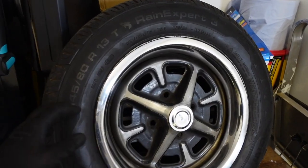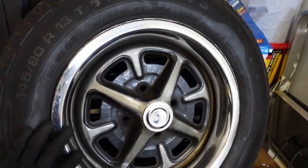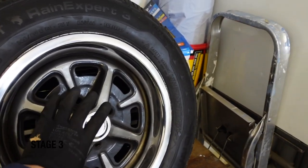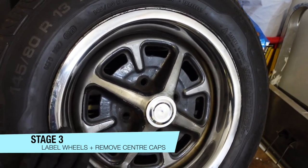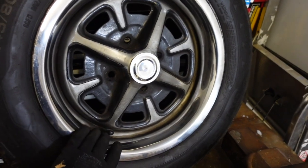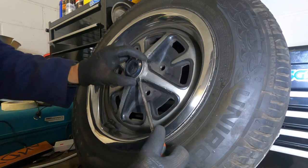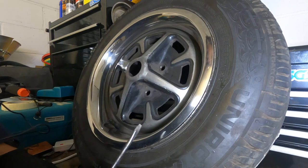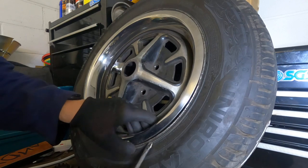Now the wheels are off and I've labelled them in a few places so I know which is the front right when I'm sat in the driver's seat — so I know which wheel goes with which hub. Next step is to try and find a way of gently removing these stainless steel or chromed vanity rings. Just a press fit I think. There we go.